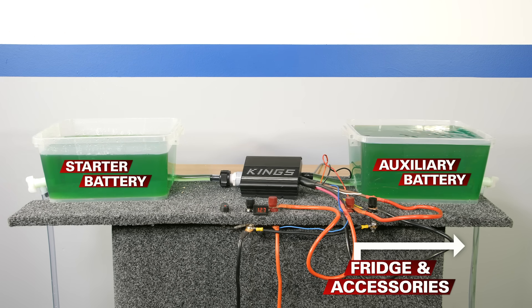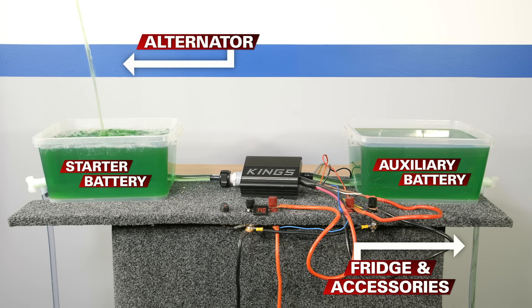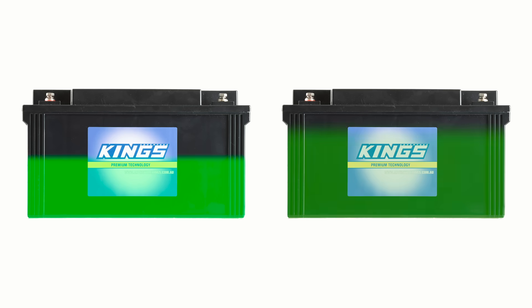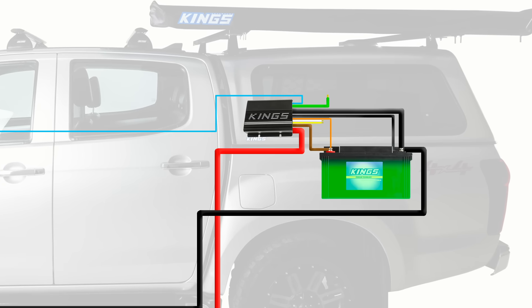There are a couple of other benefits too. DC-DC chargers directly monitor the auxiliary battery voltage and state of charge, then vary the voltage and current that they're charging — not just a constant charge like your basic or smart isolator provides. Good DC-DC chargers also read the auxiliary battery's temperature and adjust their charging to suit. Pushing too many amps into a battery causes them to heat up, and heat is the biggest killer of batteries. Because they're positioned closer to the auxiliary battery at the end of the wire run, even if there is some voltage drop in the wiring, a DC-DC charger will still provide the correct voltage to the second battery.